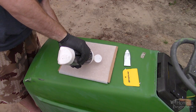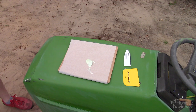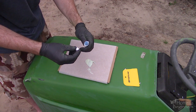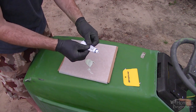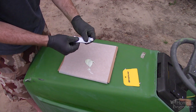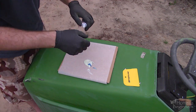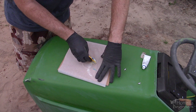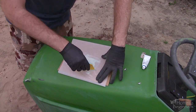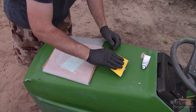Clean the area with a wax and grease remover where the filler will be applied. I'll be using a two-part spot filler, also known as a glazing filler. This is used for light coats and can have the edges nicely feathered in. A two-part product is much better quality — it's easier to work with and doesn't experience shrinkage like a single part product. Always refer to the product's application guide for mixing ratios for the filler and hardener. Push the air out of the hardener tube, reinstall the cap, and knead the hardener — hardener usually separates after sitting so this will help mix it up before use. Dispense the required amount of product onto a piece of cardboard with wax paper. Don't use plain cardboard or any surface which may absorb anything, as it can soak up the resins from the filler. Then apply the hardener. Using a plastic applicator, drag the filler across the surface to mix — do not stir as this can create air bubbles. It'll be ready to apply once the filler is a consistent color with no streaking. Make sure you do this quickly as the filler can set up before it's applied to the panel.